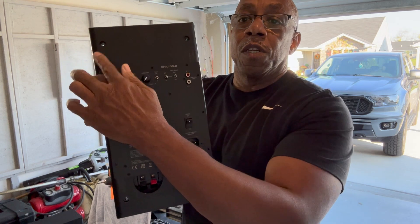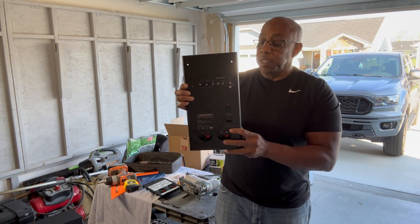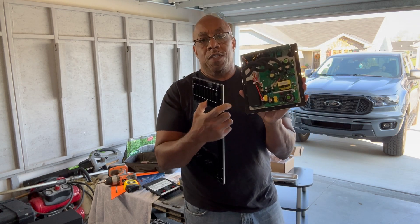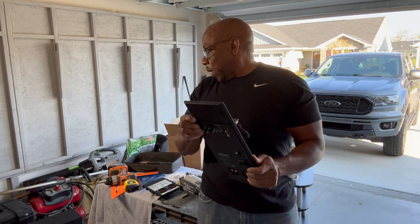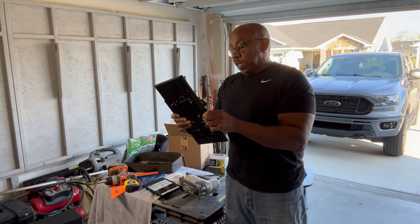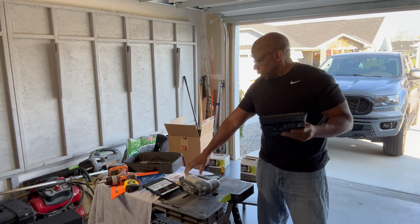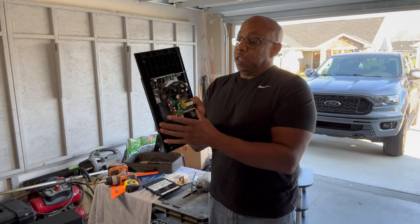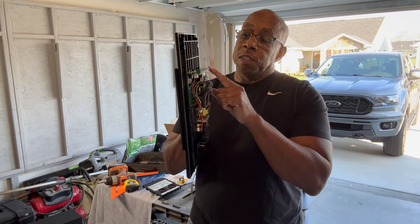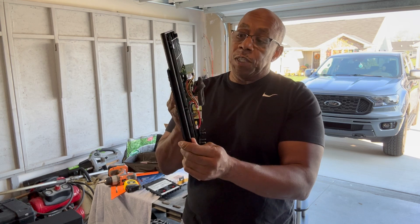I'll use these four screw holes to mount it back to the box. It did work out pretty good. The plate amp does have a foam rubber type gasket to help seal the air, and the back of the subwoofer box has the same thing that seals it around here. So it should be good as far as not losing any pressure in the box — you always want to have your boxes sealed as much as possible. My other issue is the amp drops down in pretty deep, and there is a lip inside the subwoofer box. If this doesn't drop down all the way in, I'm going to have to alter the inside of the box a little bit so the plate amp will fit all the way down in.